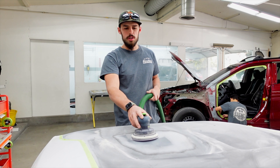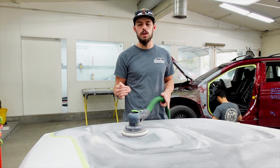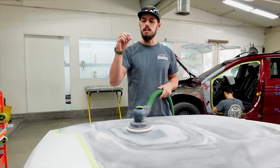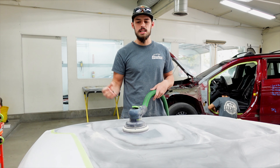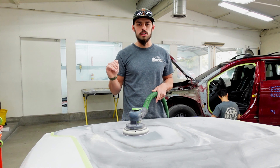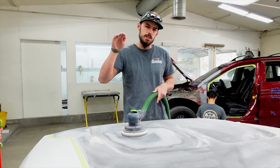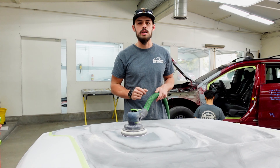It's extremely important when you're sanding on a carbon fiber finish with a top coat over it that you don't go too far down. You have your dry carbon fiber material, then there's typically a resin on top of it, and there should be a clear coat on top of that to give it UV protection so that this kind of stuff doesn't happen. If you break through the UV clear coat, break through the resin, and start sanding on the carbon fiber, you're going to distort the weave. When you clear coat it again, it's going to look all messed up. So you have to be very careful that you're just taking off enough of the bad-looking stuff so we can put some fresh, clean clear coat over the top.